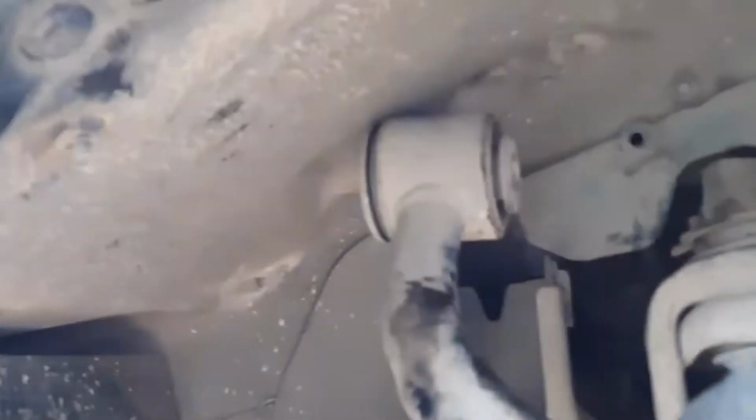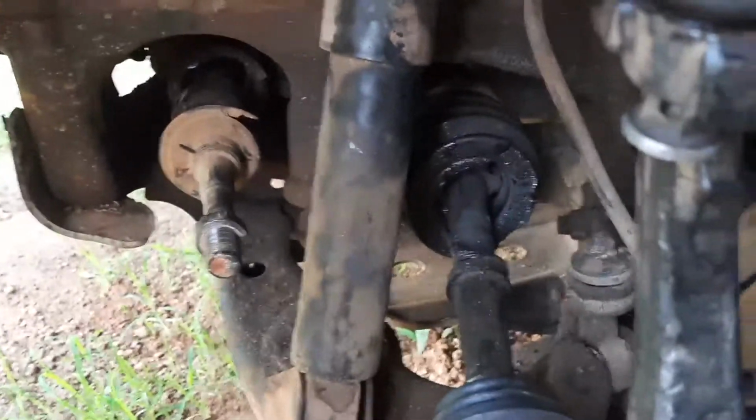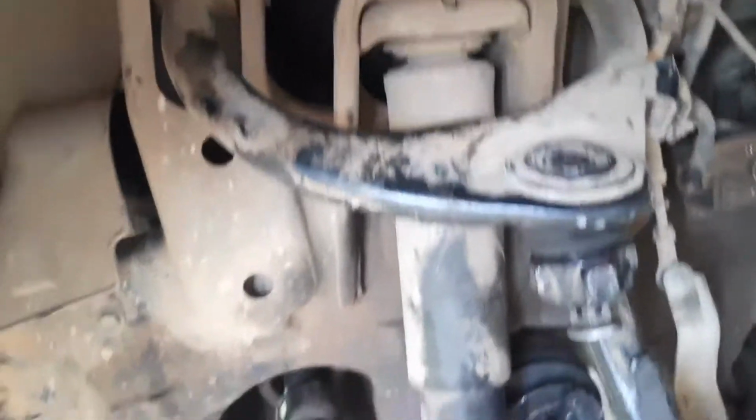Let's go. GG. Alright, let's get this jack down, and that'll be that. Yes, we have gotten it out. And now we can see everything moving out. The entire spindle is moving. But first we need to go under the car to the differential and hit out this CV axle. So we're going to hit the CV axle out from somewhere over there in that area, just so it's free from the differential. Then we can pull this down and away, and everything comes out nice and easy.